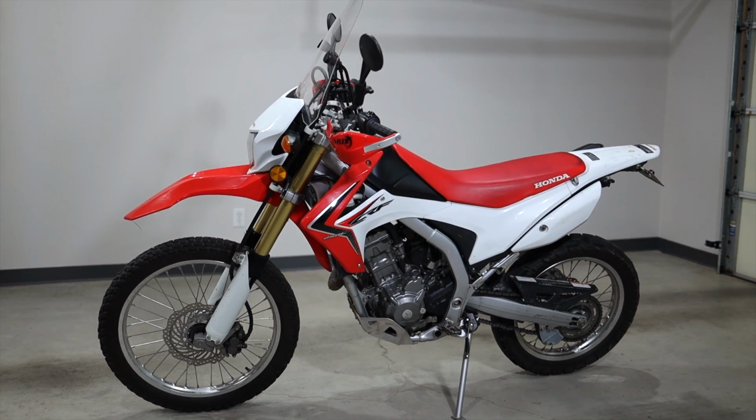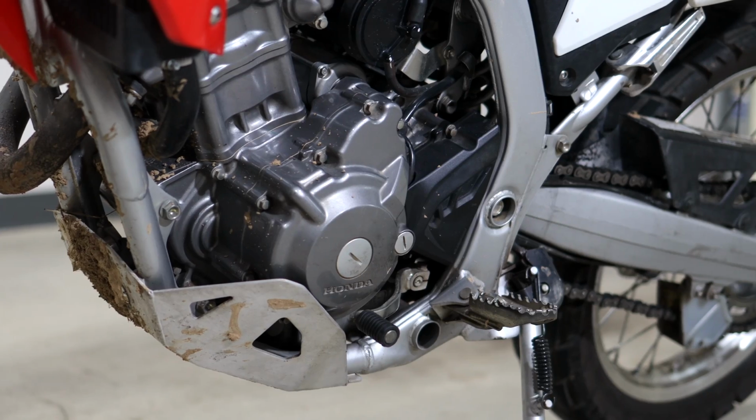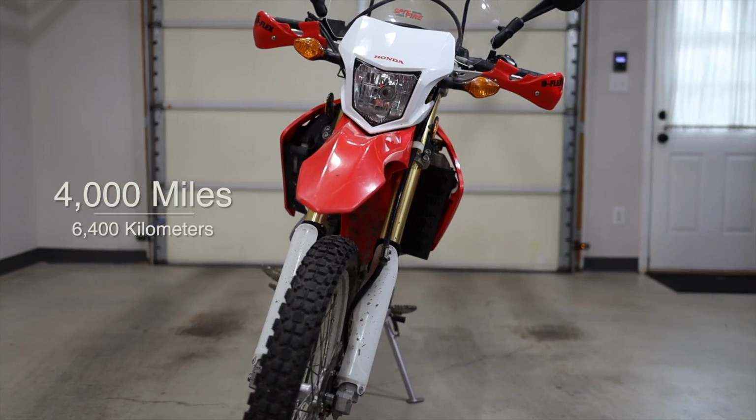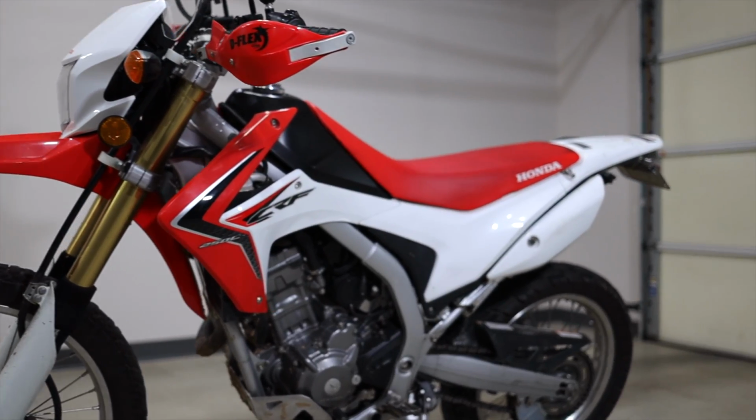In this video, I'll be cleaning the spark arrestor and the muffler of my Honda CRF250L. According to the shop manual, this regular service maintenance should be done every 4,000 miles to prevent carbon buildup from restricting airflow in the muffler and diminishing engine performance.